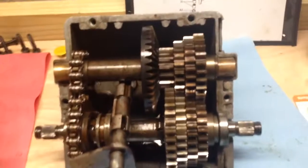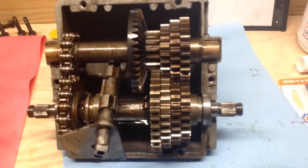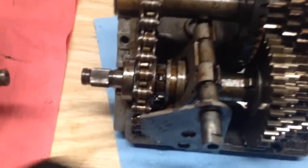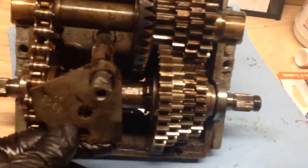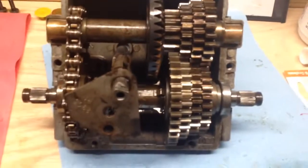Over here on the 700-039, this is a four speed — you've got four gears versus the three over here. And on this shift selector, you've got one, two, three, four, five, six positions. So the shift selectors themselves are not interchangeable. Depending on what gear you're in, these little notches will line up with the ball spring plunger.